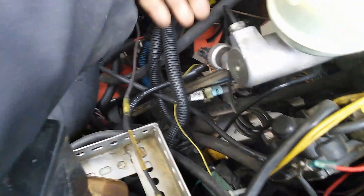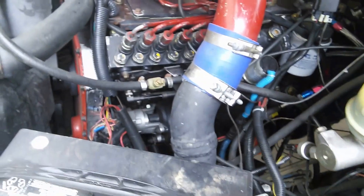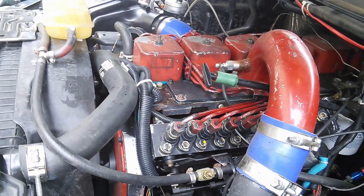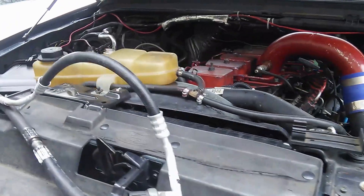You will need to tap into the power wire over here — this is a backup in case your power brake light switch fails. Hopefully I can get this intake cleaned up. I just put a new thermostat in — the Cummins thermostat was letting it go up to 195. I replaced it with a Napa thermostat and I'm back down to 170-180, even when I'm pulling.